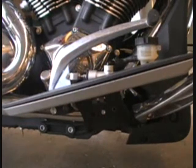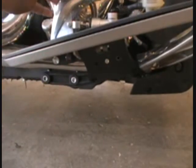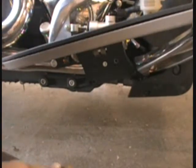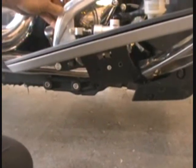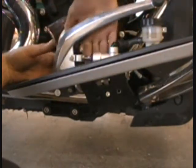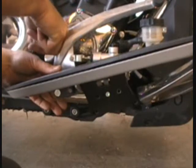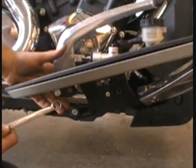The first thing we're going to do is look down underneath here — there's a bolt that goes through, there's a nut on this side and an allen head bolt on the other side. That's a little tricky to get your wrench in, but we're going to loosen that up first. It's a five millimeter allen wrench. You want to get your wrench back in here and get it in that bolt. One little trick: you want to spin your wrench down so it hits down on your exhaust pipe.